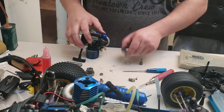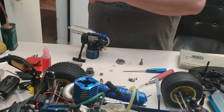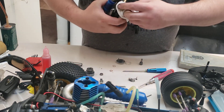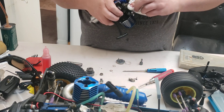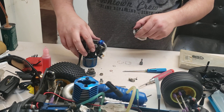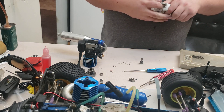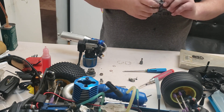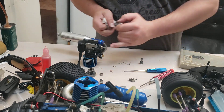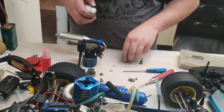It doesn't matter how much you tighten the damn thing up, it doesn't get any tighter - so that's not a good sign. I think because you do have to cut the crank short on here, what ended up happening was someone didn't cut it short enough and they couldn't get this to tighten up enough so they gave up. What I might have to do is bang this engine up, whip out the grinder, and just shorten that up a little bit.